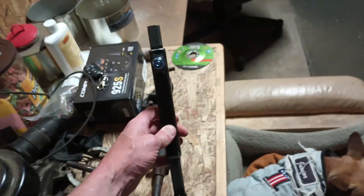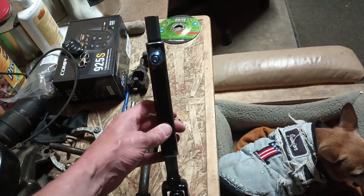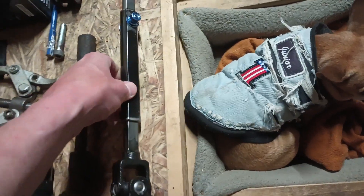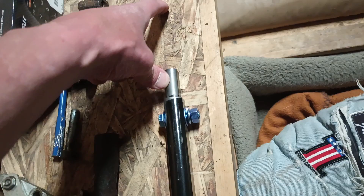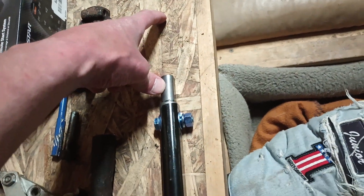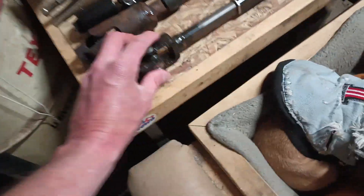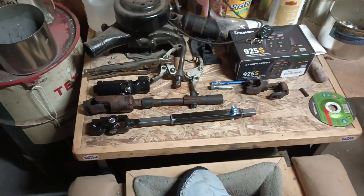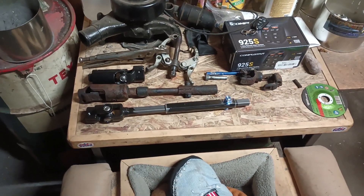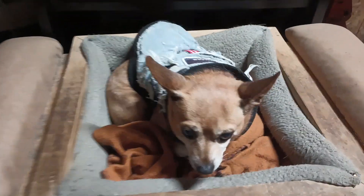I can adjust that back and forth - it'll move, it'll be whatever length it needs to be. I'll just put the u-joint on the end: three-quarter inch, 36 spline for an '89 Dodge Dakota. I know the part is obsolete but I think that works pretty good. There's no insulator in it so I'll feel everything, but it's better than six inches of slop in the steering. Thanks for coming to our channel.